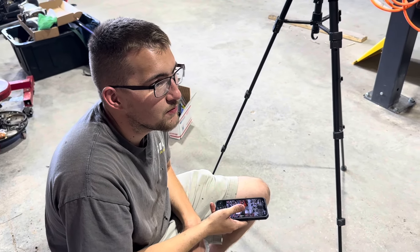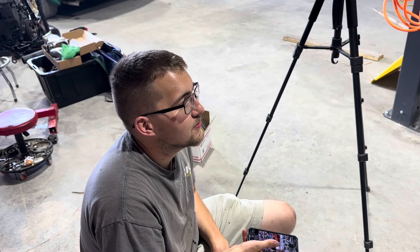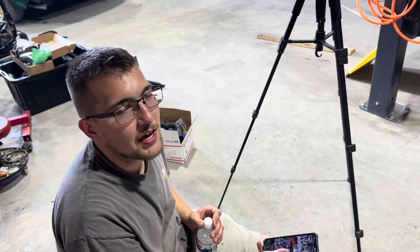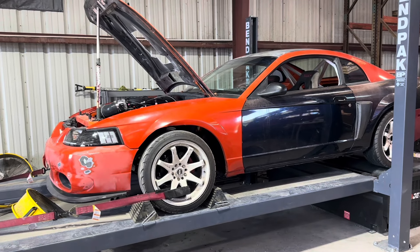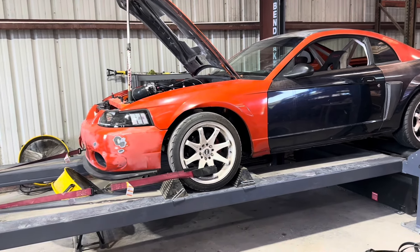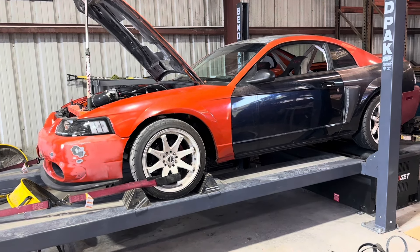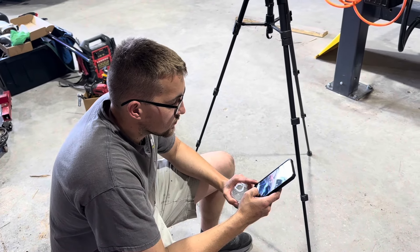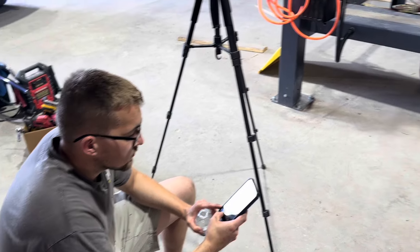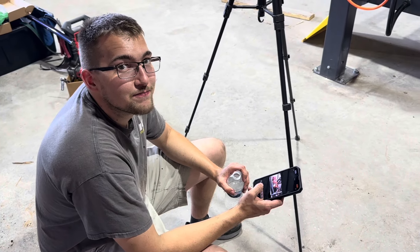It's pretty much tuned — not making crazy horsepower but it's good. I think it's around 360-370. I got all the fuel tuning done, so I'll trickle in a little bit of timing and see if it picks up. Giving it some cool down time, because when tuning standalone ECUs I can tune while the engine's running and it doesn't get much cool down. High threes is very fun and for a drift car this is going to be perfect.